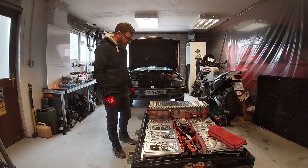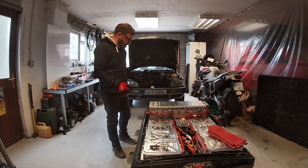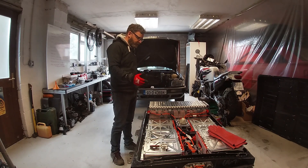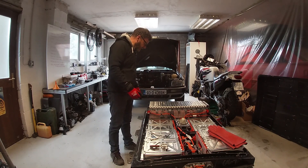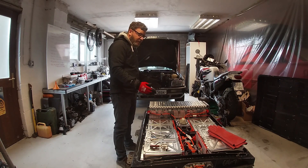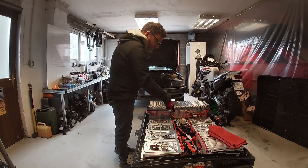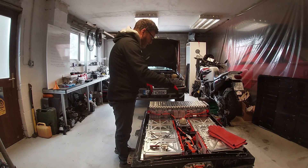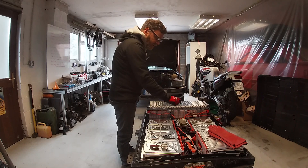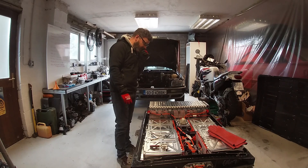The whole plan here is to break it down into manageable chunks. The way it's wired up, you can start disassembling it. At full 380 volts, you can split it by these two holes here to the main pack - basically split the voltage in half. Then you have a couple of bus bars here which you can divide the potential again between those packs. By that stage you can disassemble the high voltage junction box and start taking it apart.